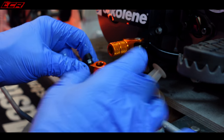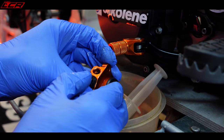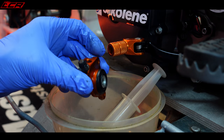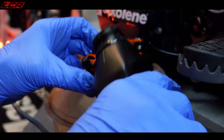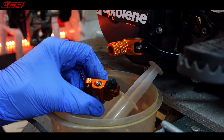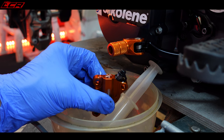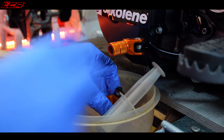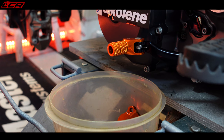Flick it, tap it, pop it. Just pump it gradually and the bubbles come out. Pump it gently - there you go. Another little few drops. Don't actually push it in, just give a little bit of pressure on it. Keep doing that until basically it stops bubbling. If you've got an assistant to hold that it'll make things a lot easier; if not, just rest it down gently.